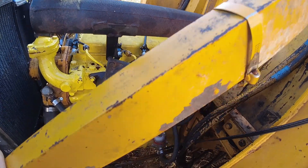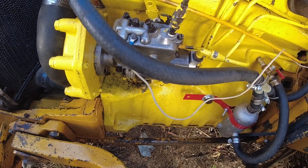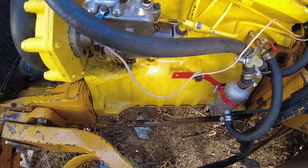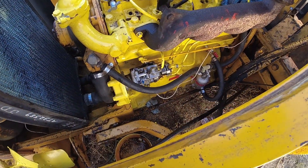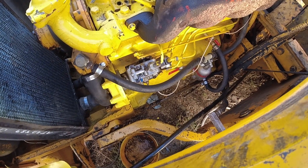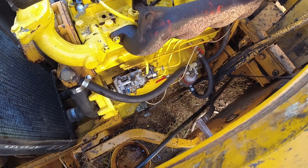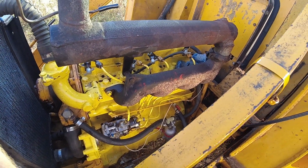We found out that it is not. We believe the injection pump is 180 degrees off from what it needs to be. I already pulled this pump off once and rotated the pump 180 degrees. Either I totally messed that up and it's still off, or it was correct originally and I then got it off by rotating it.